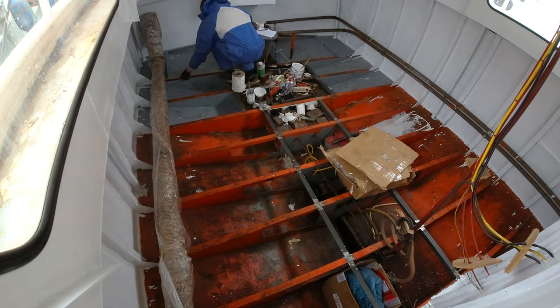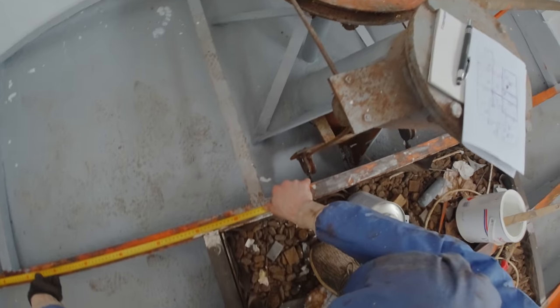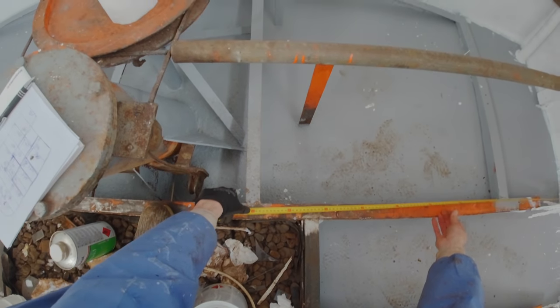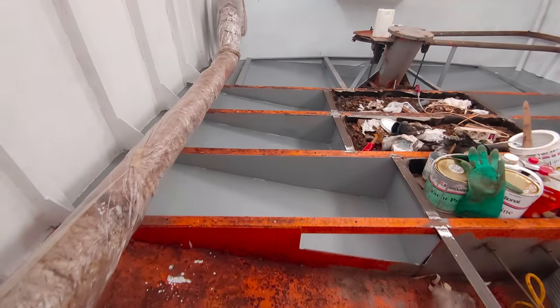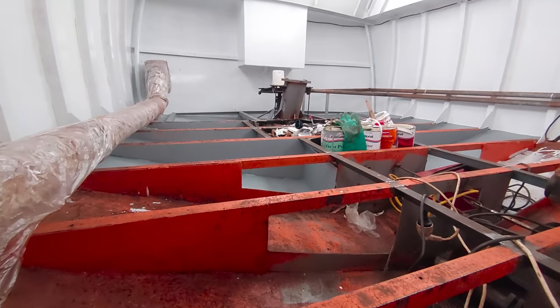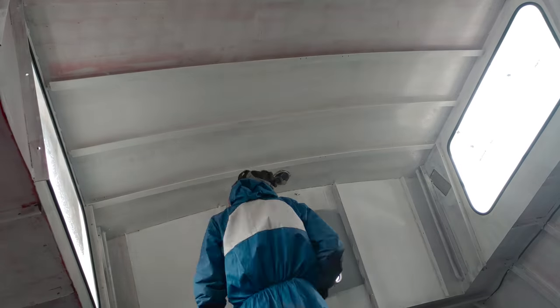This week it was also time to measure the aft cabin's floor so that we can order the wooden floor panels. This allowed me to draw up a plan - I'll explain that another time. I just finished measuring the entire floor and I want to show you something: on one side we have 107 cm and on the other side about 110 cm - that's three centimeters off. It turns out the entire floor structure was constructed with a two to three centimeter tolerance, so we're going to have a lot of fun putting those floor panels in.